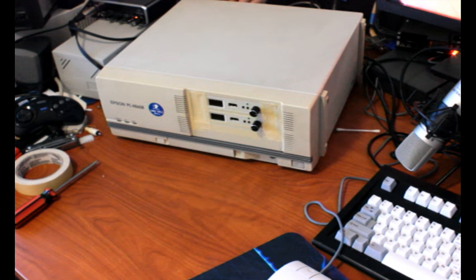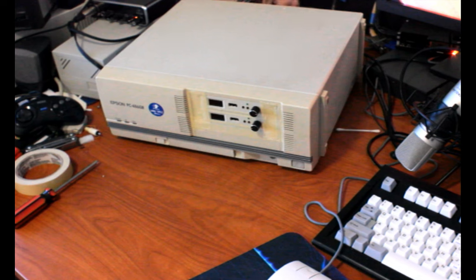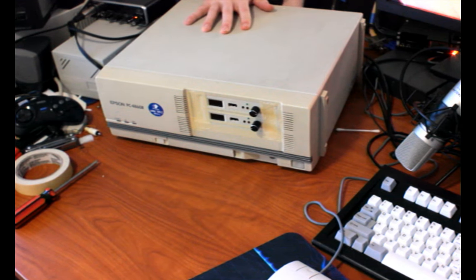Okay, so blue was on the right and yellow was on the left, I believe. Good thing I emphasized that to myself, or I would never remember. Plugging in the monitor adapter. I've got a serial. Yeah, the other connector I didn't mention was the RS-232 DB25 connector. And then there's also a digital RGB connector, which I believe is an 8-pin DIN connector.